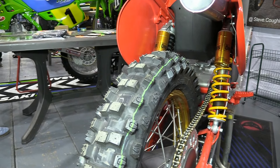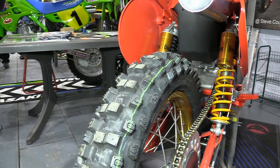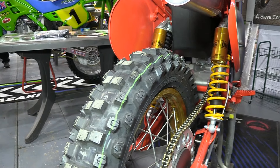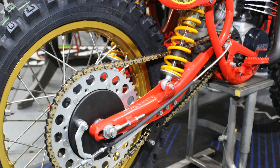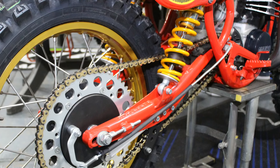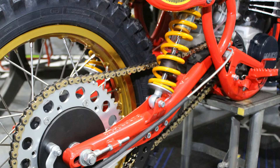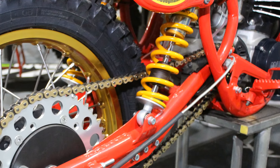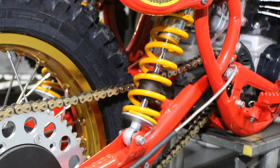To keep this back end of our '79 400 stable, Steve has gone for a nice pair of top-of-the-range Swedish Öhlins piggyback units, which are a hundred times better than the old Corte e Cosso units that Maico fitted to these old twin shockers in '79. These Öhlins are highly tunable with regard to rebound and damping settings and can be fine-tuned to suit the rider's riding style and personal weight. Steve told me it was Kai's Suspension who supplied these particular units.